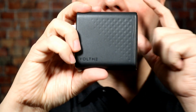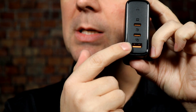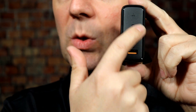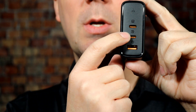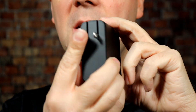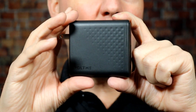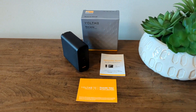Starting on the back, there are three ports: two USB-Cs and a USB. They're labeled here. The top one with a little computer icon is the one that's truly capable of delivering 140 watts at once. The second USB-C, if you only have one thing plugged into it, is just 100 watts, and the USB-A maxes out at 22.2-watt charging. It does come with a foldable prong for travel. It is kind of a large charger, but it's a 140-watt charger with three USB ports — that's pretty cool.